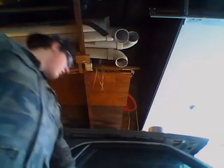But pretty much, I did do the truck bed of the car. That's all stripped down and primered. I'm not going to bother bondoing it or anything. I'm just going to put truck bed liner in there. If I feel like it needs Bondo, I'll go through and add a little bit and harden it before I do the truck bed liner. The interior of the car, I'm going to be replacing the bench seat that's in here.